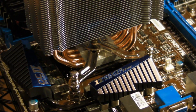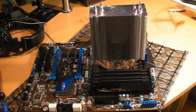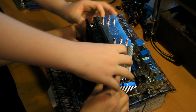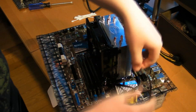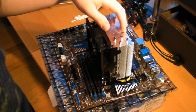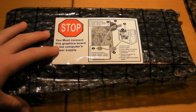It did work eventually, though it is a very tight fit. It looks pretty clean because there are basically no cables yet. This is how the fan goes on — I found it almost required two people every time because it has little finger hooks that you have to pull out, and there are four of them. They're kind of hard to grip all at once, but with two people you can just shift it down. Now it is slightly raised but it does fit, and that's just cable management.